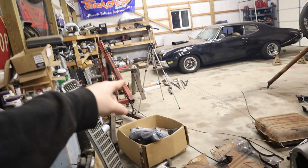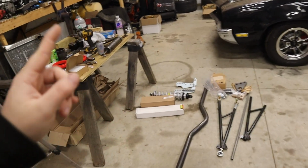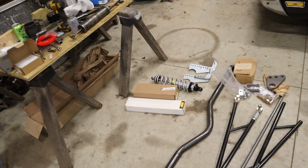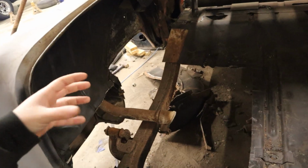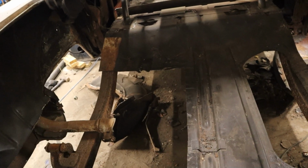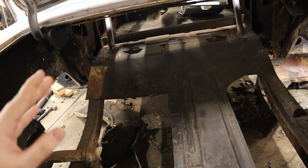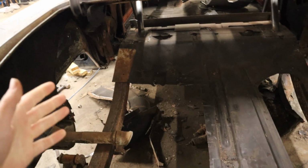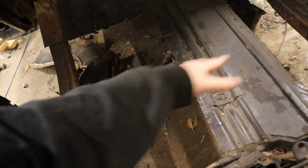So the plan is, got the ladder bar kit over there on the floor still, that front cross member there. We're still going to use that, and we're going to build our back half off of that. I am going to triangulate everything as much as I can. So we're going to get that cut to the proper width to fit in between the frame rails. I do think I'm going to cut some plates to weld to the frame, just a little bit extra surface area on the welds. In my mind it helps. I don't know if it actually does, but it makes me feel a little bit better. Once we get that, I'll probably do one tack on each side just to hold it in place. And then I'll probably start getting the bars bent up to go up and over the rear end. And we'll see how much tubing we have, and that's going to be the deciding factor on where our crossbar back here is going to mount.